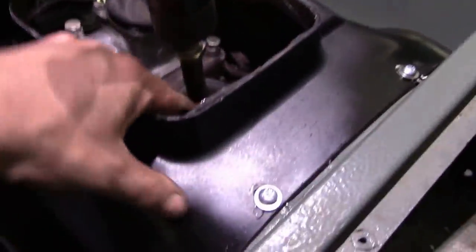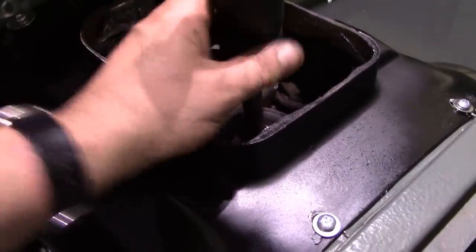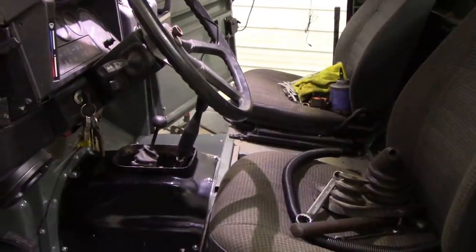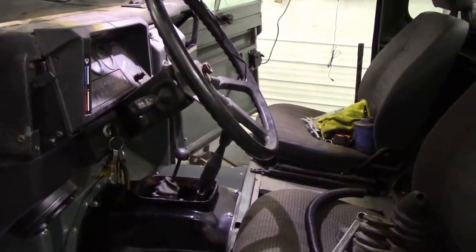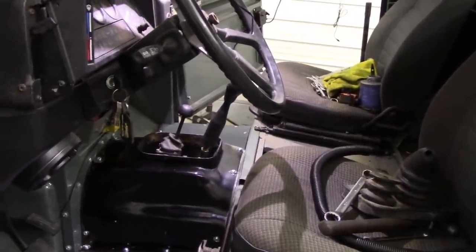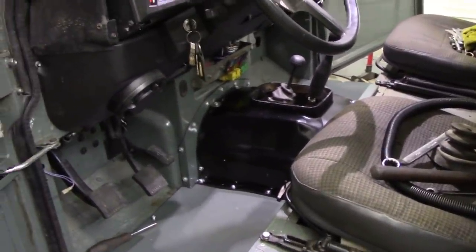I'm thinking I'd like to keep that lever — Jim's going to make me a vinyl cover for the transmission cover — but I'm thinking about warming it up, taking this lever out again, warming it and making it straight. So in neutral it would be like that, and in second it would be like that — that would be perfect. It's one of those things you never find out until you get it all together. Alternatively, I can take the gear stick mechanism off without taking the tunnel out again. Taking the tunnel out is a dream — I wish I'd thought about taking the handbrake cable off ages ago because it was so easy.